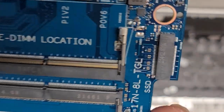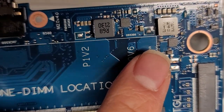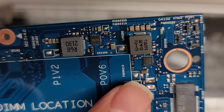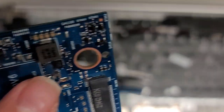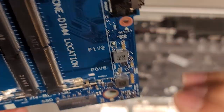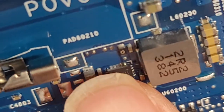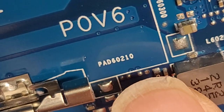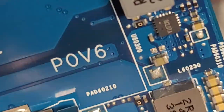I'm back. Here you can see the difference — I cleaned that off, there's no more of that burnt area. Hopefully it was just shorted here and didn't have a component burn and fry off, because if those things burnt off, we're likely not going to get it working. This other one looks pretty bad too — the feet on that component are all shorted together. Before, this was the burnt area, so I don't know if it had one of those little components on it. I'll try to clean this piece up.